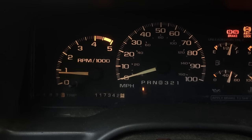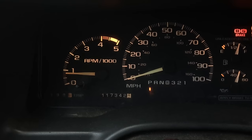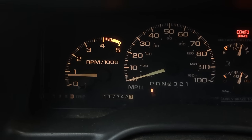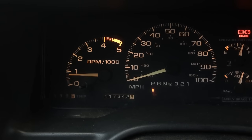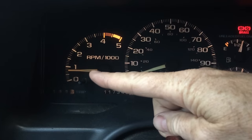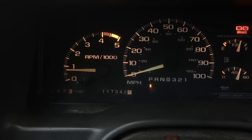So that's what you're looking for. What the throttle position sensor does is it senses the position of the throttle — thus the name. So when you're stepping on the gas, the engine doesn't know what your foot is doing and gets confused about what to do. So if your engine's running smooth at idle but then it bogs down and hesitates while you're trying to rev it up, that is the problem.